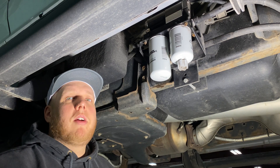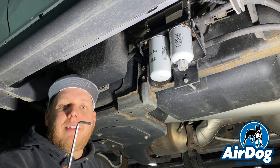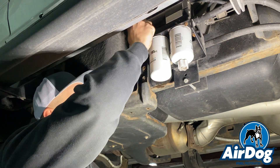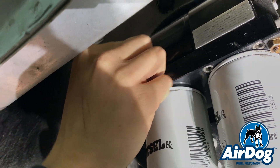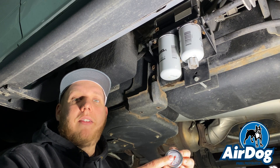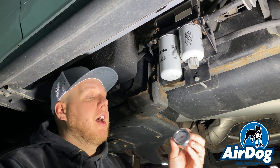We've got the truck up here on the lift and we've located our brass 90-degree elbow. We're going to take a 3/16ths Allen wrench and remove that pre-installed 1/8-inch MPT plug. This does have a thread sealant pre-installed on it, so it'll kind of be a little snug the whole way out. We're going to be installing a liquid-filled 30 PSI gauge directly into the pump here, and then we'll do that fuel pressure splice a little bit further up line.